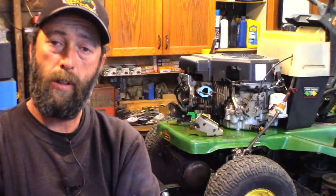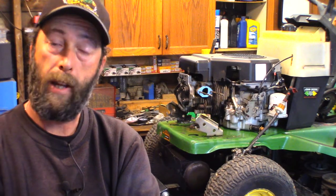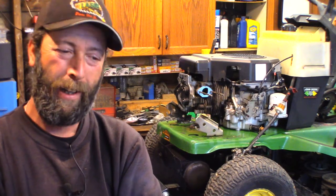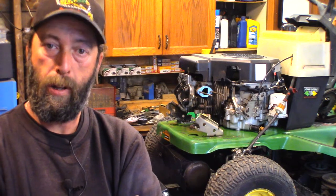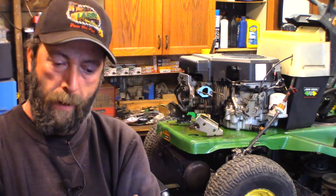Okay, so I'm back from the parts washer. I got the cylinder head as clean as I'm going to get it. Can't see it, don't matter. I got the tins cleaned up. I wanted to get the grease and crap out of them anyways, because it impedes the airflow for cooling. I've got the cylinder head on there with the new gasket.